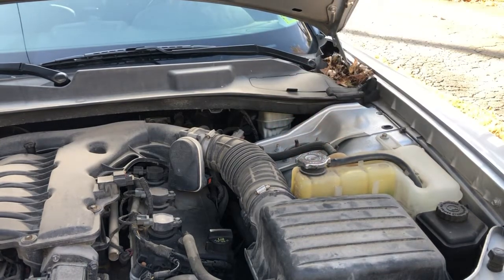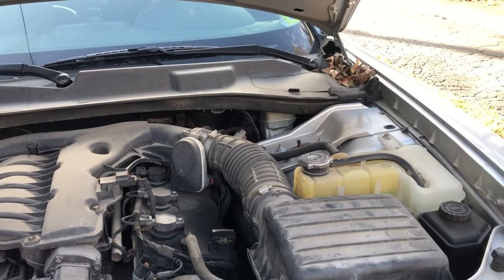That's all there is. That's how you refill or check your antifreeze level in your car and go ahead and fill it up. This is for a 2008 Dodge Charger but the same concept can be used for any different model or car. Just make sure that you always do it when the car is cold. Thank you for tuning in to this video.